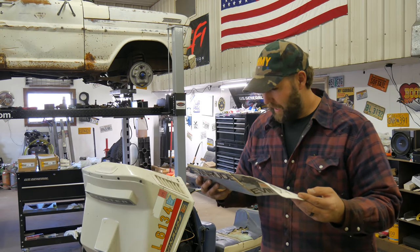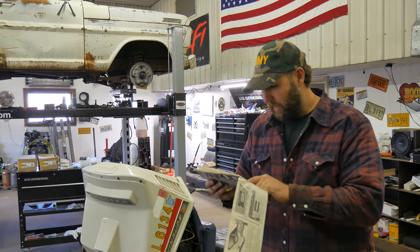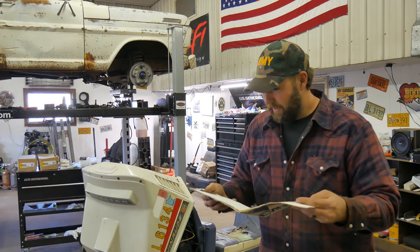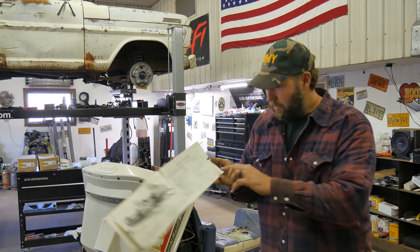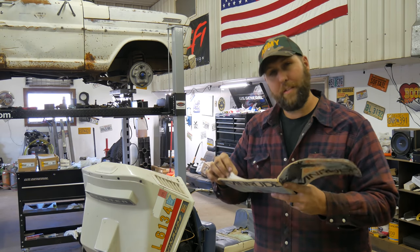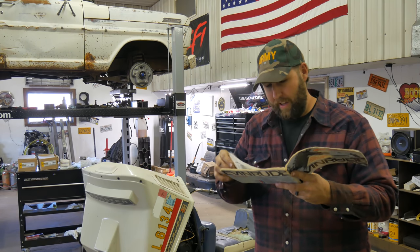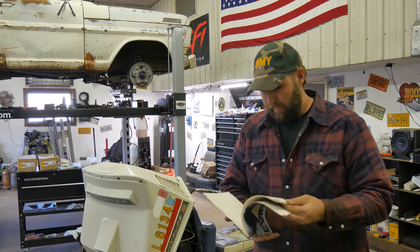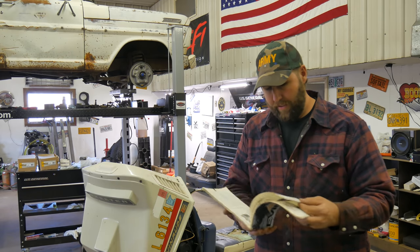This particular machine came with the original owner's manual, and you can tell it's an old timer's writing because they just had better penmanship back in the day. There's a ton of notes on almost every single page, which is really cool. Digging through this, I could see he's had some starting problems: clogged vent, mixture too lean, bad plugs, air leak somewhere - question mark. Had a primer bulb issue. He changed the fuel mixture to 50 to 1 - not really liking that too much.